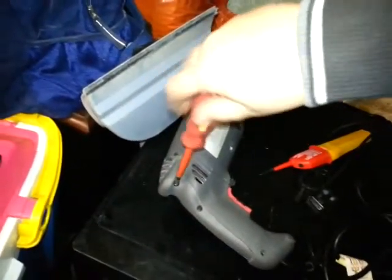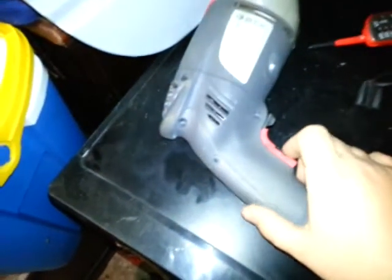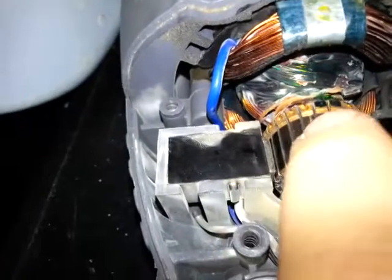So after we've undone these 2 screws, we'll find out what's died. This part, all the screws are off. That's it. That's basically all it is. So, as we're looking at it, this is a speed controller, and that is a motor. The motor does look pretty sad. The commutator bars don't look the greatest, and the field windings look rather rough, to be totally honest. But the brushes are still good, and everything else is still good, supposedly.